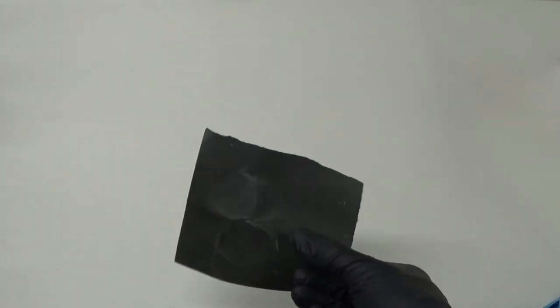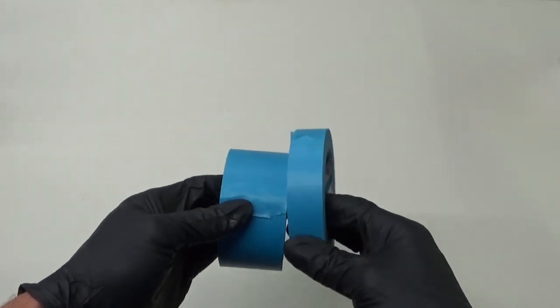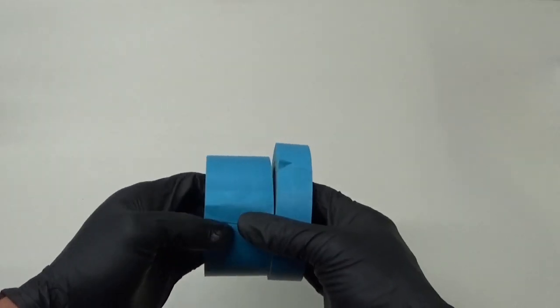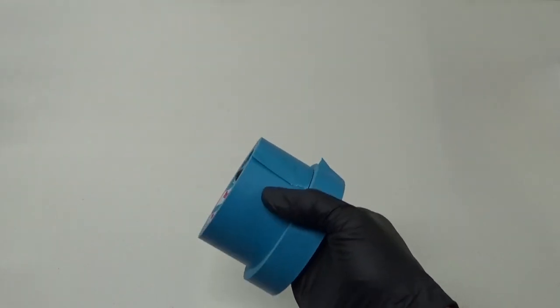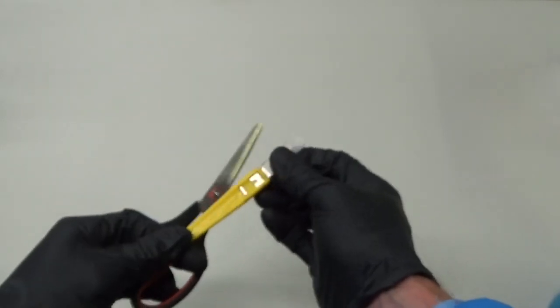Use the lightest paper you can get away with — you don't want to go really heavy on the grit because it might scratch too deep into the carbon fibre. Start with 400-grit on that. Once rubbed down, mask up the frame — where the bearings sit and everything — using low-tack masking tape in one inch or two inch widths. Low-tack means when you pull it off it doesn't leave sticky residue, it just peels straight off. Don't use normal masking tape as it leaves sticky residue everywhere.